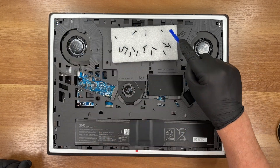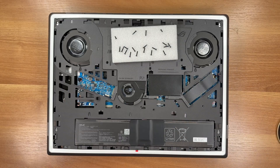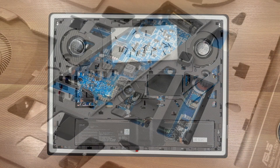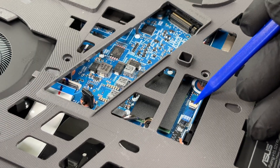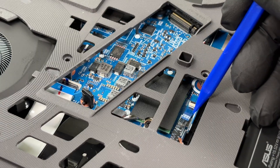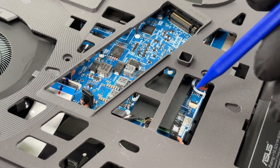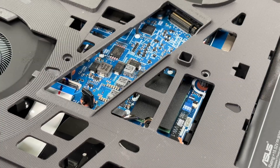Here are the two short screws alongside the other 17. After removing all screws, our first task is to disconnect the ribbon cable that links this cover to the motherboard. Asus recommends discharging the battery below 25% before opening the device, and we'll remove the battery as well.